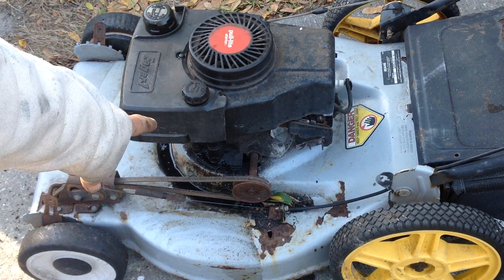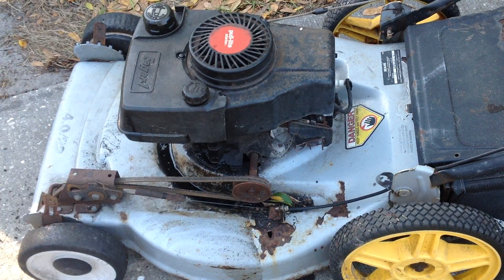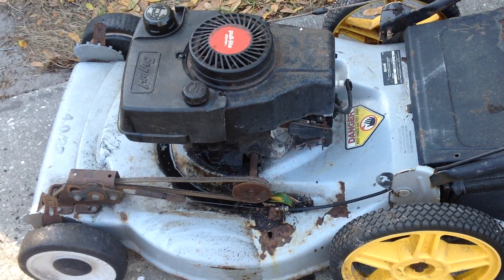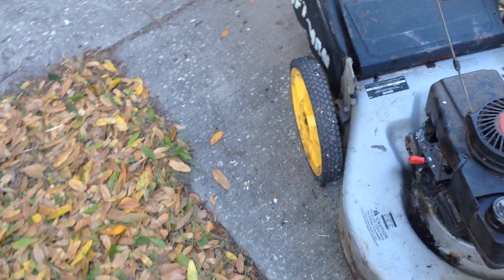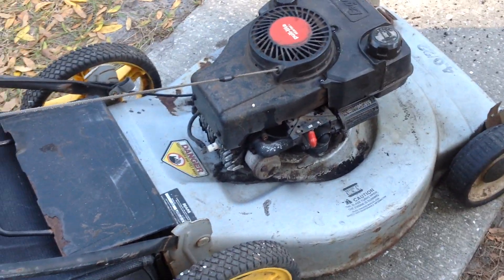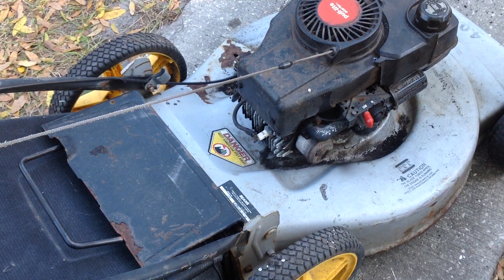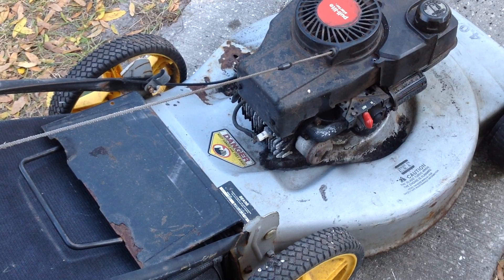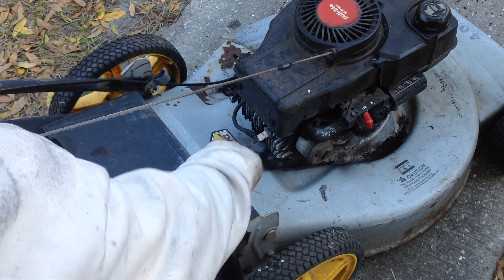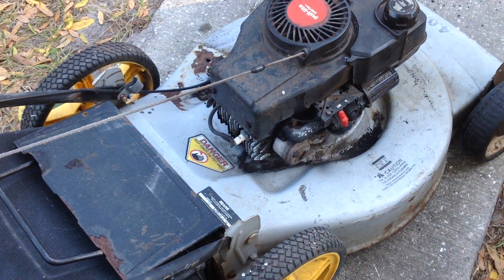This oil here was when I took the recoil off — some oil poured out of the oil filler tube. I'll clean all that up if I have some further success with this thing. In order to sell this to somebody and be confident that they can turn it off, I'll have to rig up a piece of sheet metal like the old engines had where you kill the plug. I'll hook up a piece of sheet metal and probably attach it here, make it long enough to go to the top of the plug — that's how you would kill the ignition.